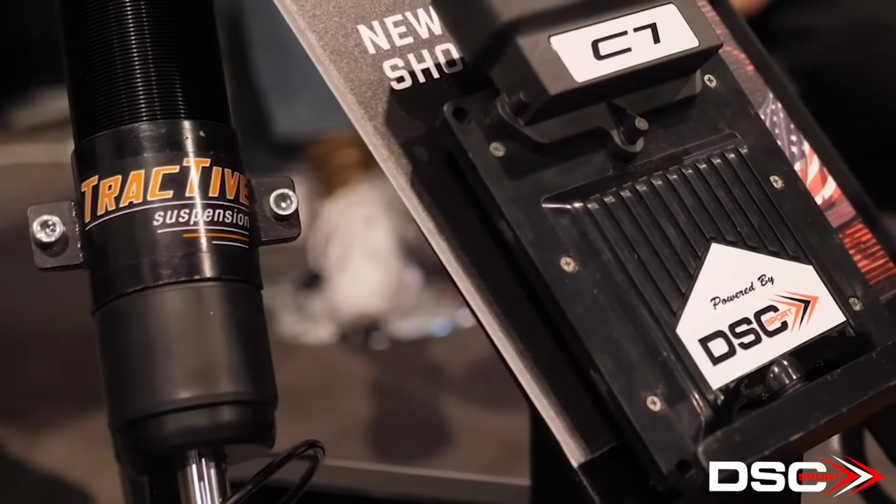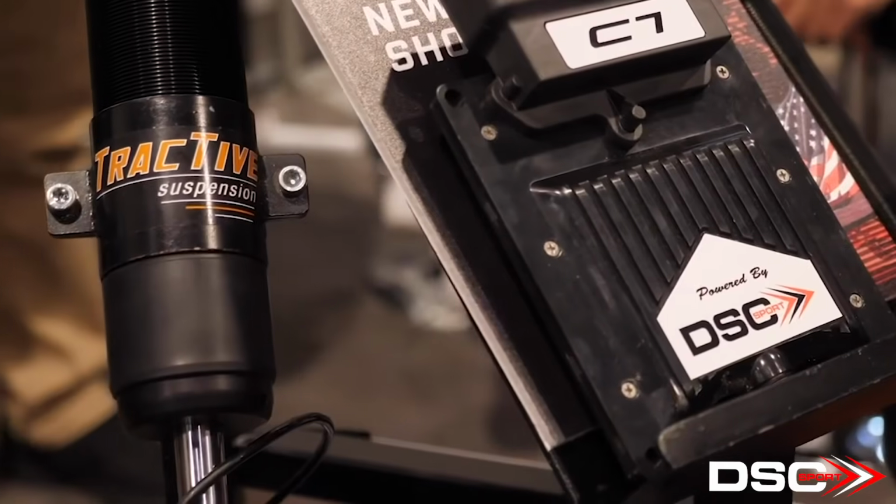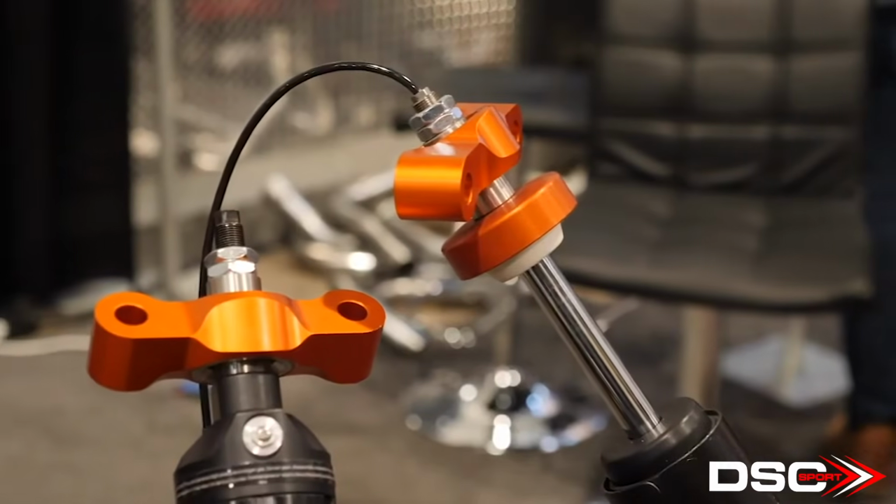That's a really important aspect with tuning the bump stops as well. If you're going to be running onto them, a lot of people run a very, very hard bump rubber, and essentially as soon as the corner of the car runs onto that bump rubber, your spring rate essentially goes to infinity and overloads that particular corner of the car. So what you're talking about there is tuning the damper position where the bump rubber will start to contact, or the electronic bump rubber starts to contact, but then you can also control electronically the stiffness of that bump rubber? Yes, that's correct.